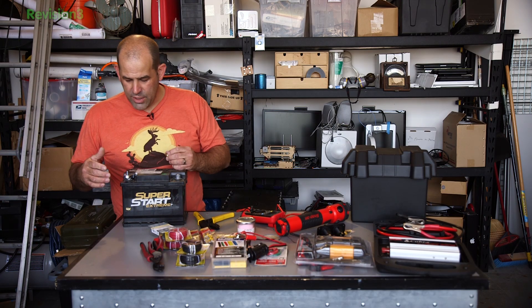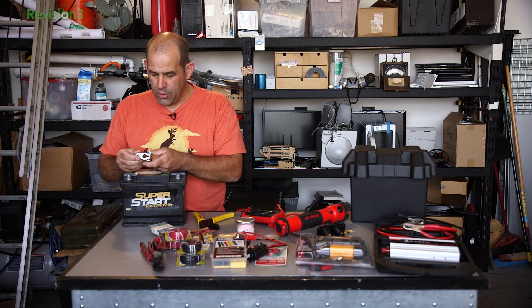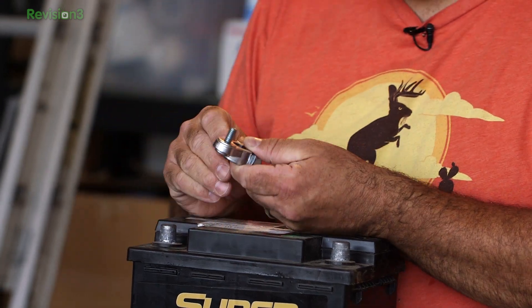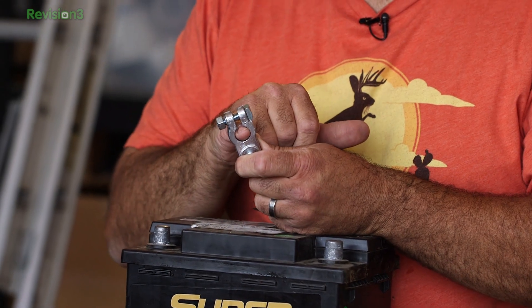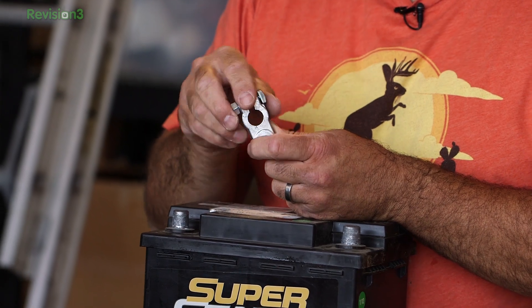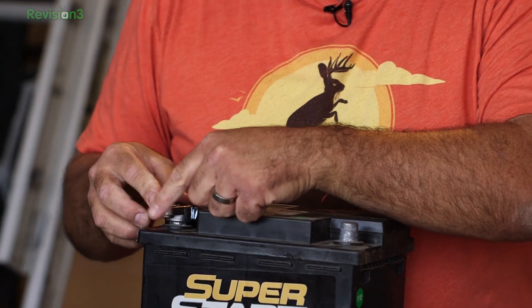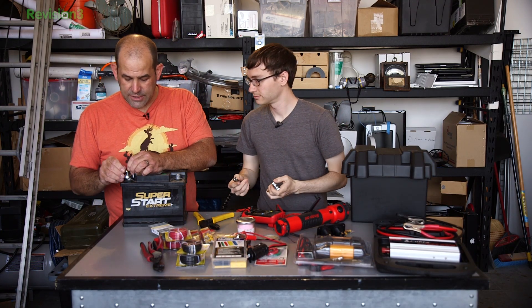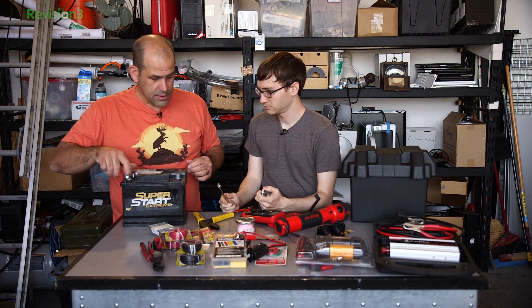While Michael's finding a wrench to fit this battery terminal — these are marine battery terminals, sometimes called military or tactical battery terminals — the idea is you use one bolt to tighten the lead terminal onto the battery and another to attach your devices. One size is 5/16ths, one size is 3/8ths. We're going to attach all our various devices with ring terminals to the top here.